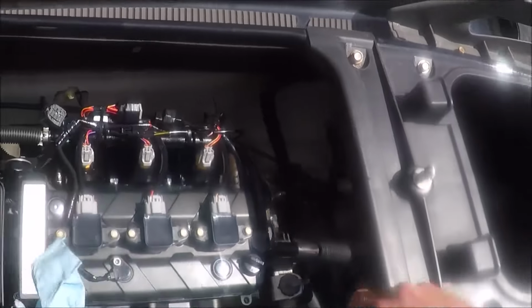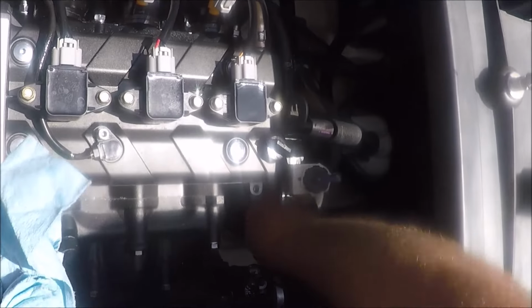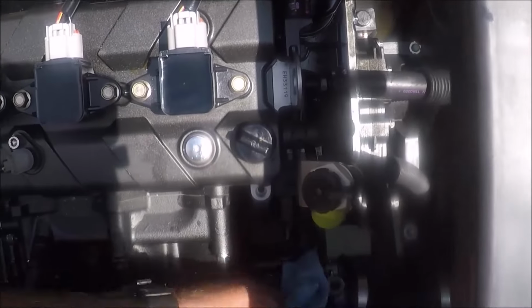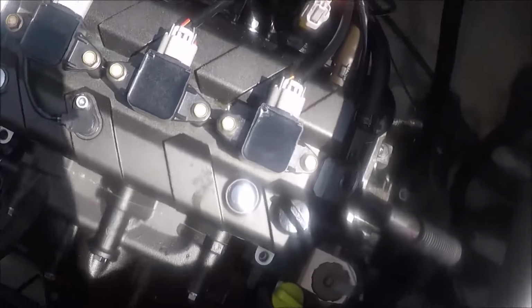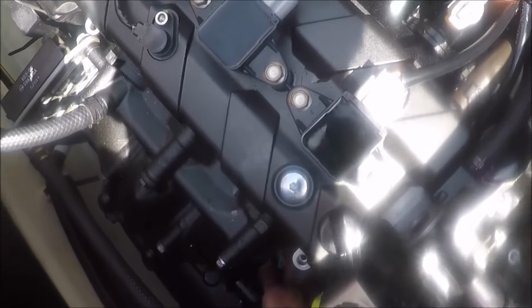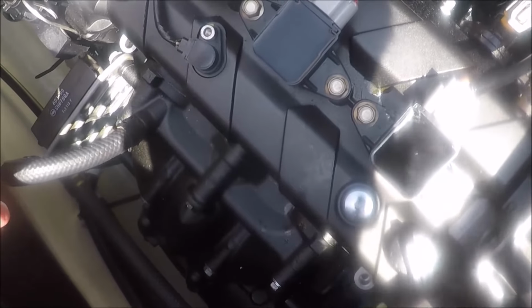And you can't just check it at this time. You do have to run the Waverunner just for a little bit, because that's how you always check the oil on these. Run it for a while. Says 6 minutes to warm them up. I don't do that on the oil change side of it after putting the new oil in. I just run it for a couple of minutes. So just cleaning up all the oil in there, making sure that I'm not going to have a mess left over.